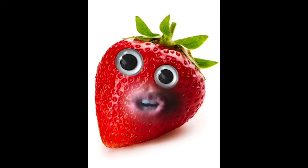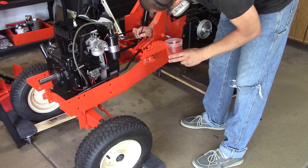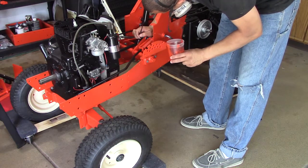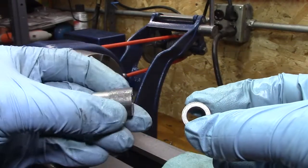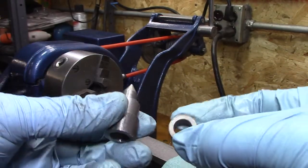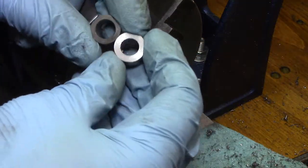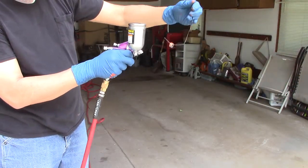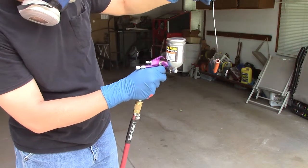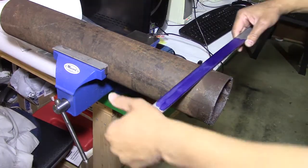Good one, Jayster — finally a fruit joke. I had a couple of battle scars from the springs and stuff, so I got out the touch-up paint and fixed it. My father had washers in place of a bushing, so I'm going to take this piece of scrap metal and make a bushing on my lathe. The diameter is slightly different but I made it to fit the bolt, and here I am painting it. I had enough paint to actually paint another bushing as well.